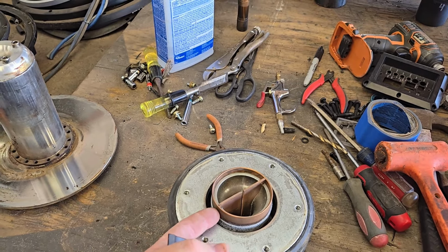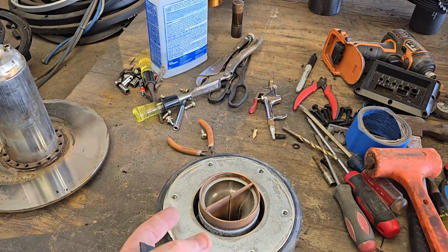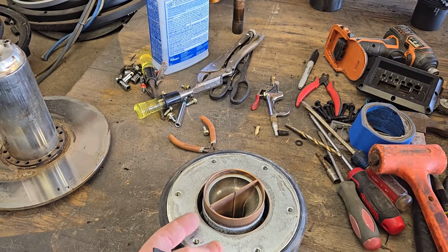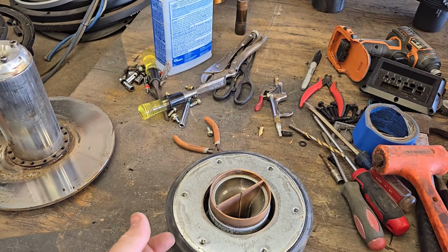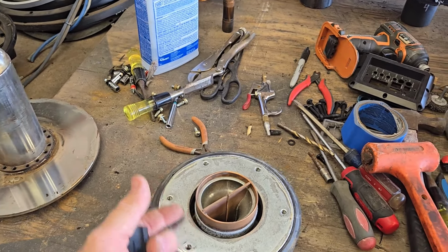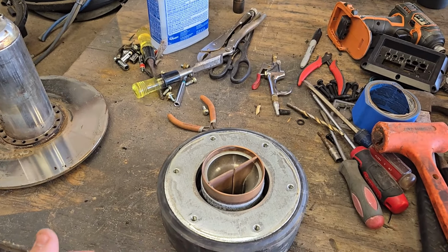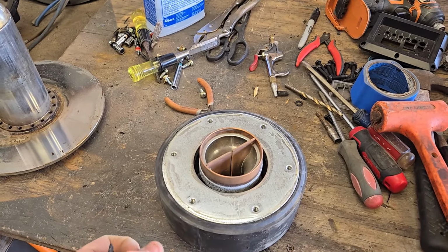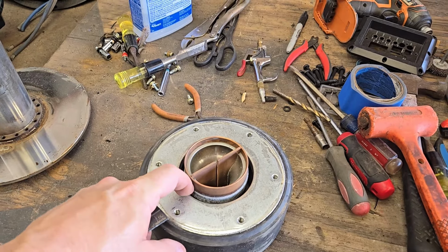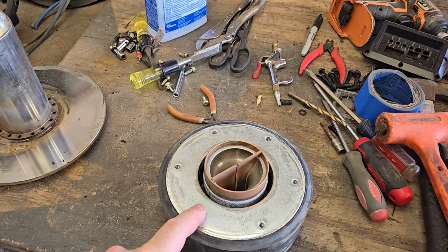Now, some of the standard coils out there, like Jacob uses on the SA Classic, actually use 3 business cards, which is 1.5 millimeter all the way around, so on each side. I don't agree with that, but you know, whatever. That's his way of doing it. It's nice and floppy sloppy. But basically, the closer proximity that you have, the better the heat transfer.